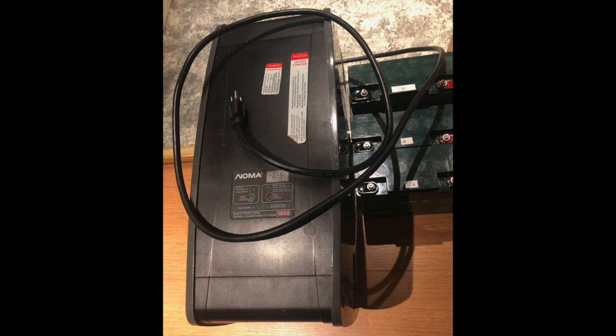You can see the split between the top panel and the front panel. The front panel does not have to come off — it can make some things easier, but you cannot get the batteries out through the front because electronics block the access. Two side panels come off easily, four bolts each. The top panel lifts off; it's not held in place by anything but the control panel. The side panels define whether you've got the front and back panels located properly, because they're adjustable.